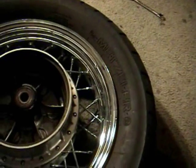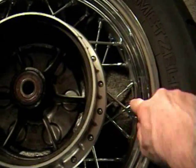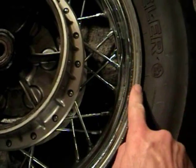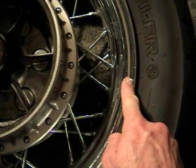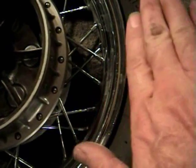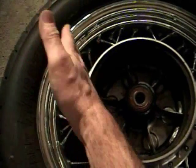Let's take a quick look at how rims are put together. You see where the spokes are — this area right here is indented, or recessed. See, it's in here, and then it goes out. There's a gap about this far. So what you want to do is, where the tire is, it's in behind here — when you're pulling from the other side, you want to get this piece of the tire down and into this recessed area, so then it will go down and move over, making it easier to pull the tire off of that side.